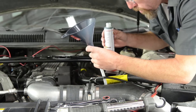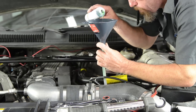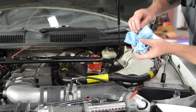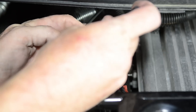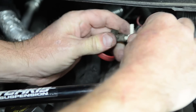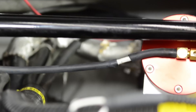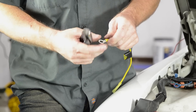Now we're going to go ahead and add the oil to our ProCharger head unit. The ProCharger oil is proprietary and comes with four bottles — the first bottle is good for the first 500 miles, after that you change the oil in your head unit every 6,000 miles. ProCharger also has a dipstick to make sure the oil is not low. Now we're going to tee into the vacuum system, which is required for both the FMU and the compressor bypass valve. When the compressor bypass valve sees a vacuum it opens up and allows the excess boost to vent to atmosphere. On the FMU side, as it sees pressure it increases the fuel pressure to cover the extra boost that the blower is making.